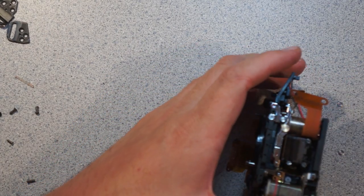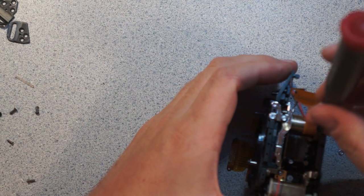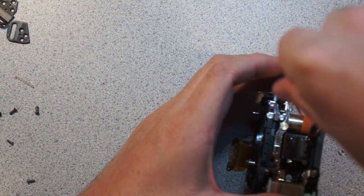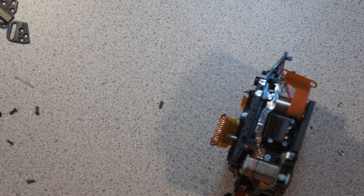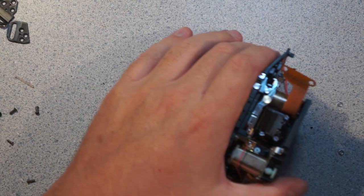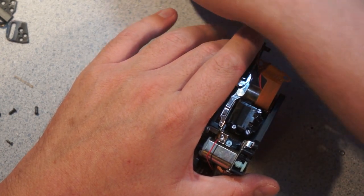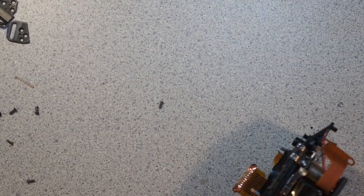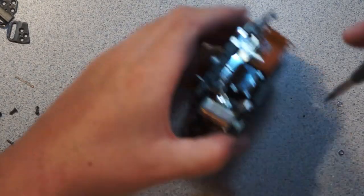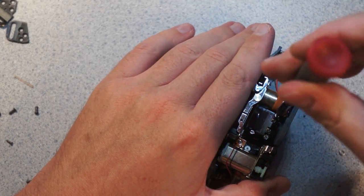So now that I'm down here, why don't we take the AF sensor out all the way? I don't know if you can make it out, but you've got a smaller slotted driver. You can see these three adjustment screws, assuming I don't drop the screwdriver and lose a bit somewhere. But as I adjust this, you can see how it moves slightly.